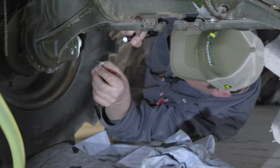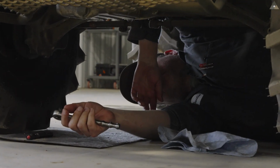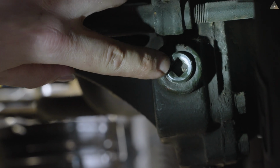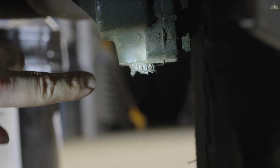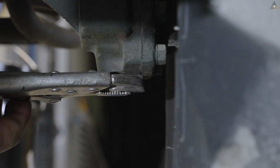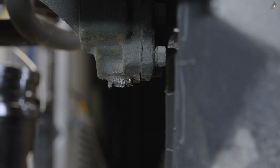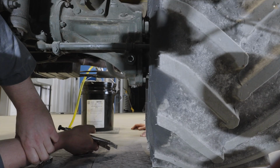And I can see the gear in there and it looks pretty clean. I'm gonna have a problem with this plug. It's all rounded out. Yeah, so as you can see right here is where your ratchet fits into the plug. On the drain, it's all rounded out, and you can kind of see teeth marks on there where somebody's probably put a vice grip on it. We'll probably try the same thing to get it out of there, and then we'll replace it with a new plug. Nope, shoot. I think we got those big easy outs.